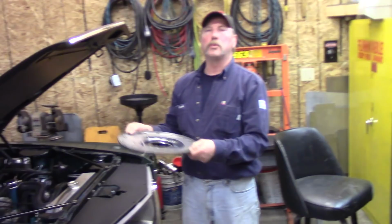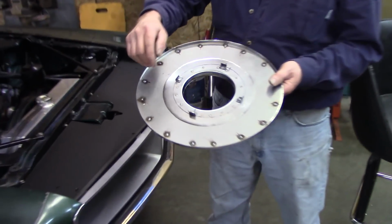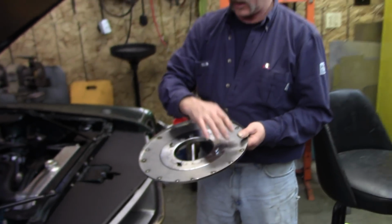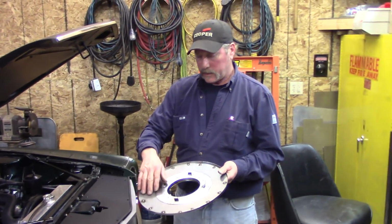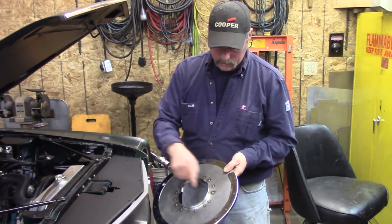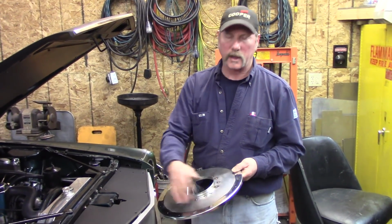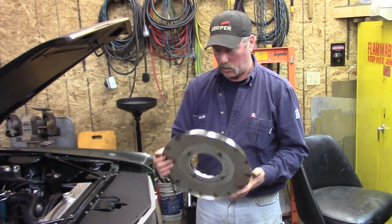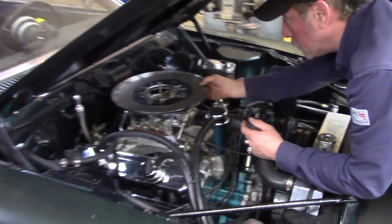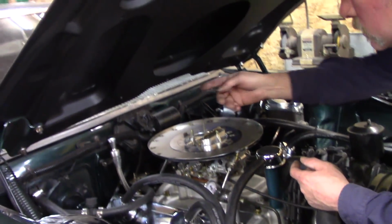Well, here's the finished product for the base. You can see where it's been spot welded. This holds the element. This has got to be ground, seam sealed, and painted underneath, with seam sealer around here, and paint this too. It's got to be scuffed up to get paint to stick to chrome. Then you'll see how this is now wider than this hole.